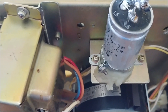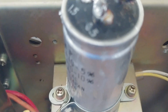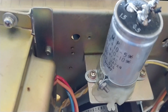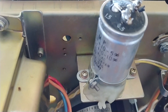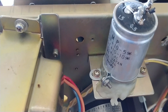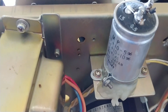By the way, if you are having any kind of problems like this where it's running sluggish, one way to check this is you can usually look at the top of this thing. As you can see, I've already started taking this apart, but you look at the top and usually they'll be bulged at the top. That's the indicator — it gets expanded in there. There's some cardboard and weird mixture of paste in there. As it starts to fail, they expand and it pops the top out. So it's kind of a dead giveaway. There's also ways to do it with a voltmeter, ohmmeter, whatever. But honestly, if it's running slowly and having issues but everything else seems fine, it's probably this.